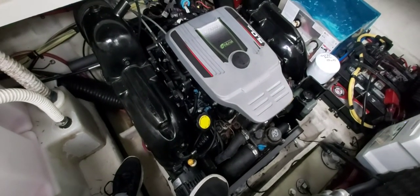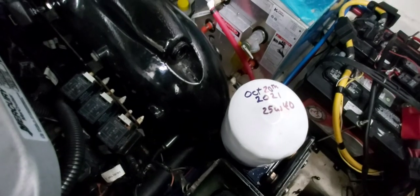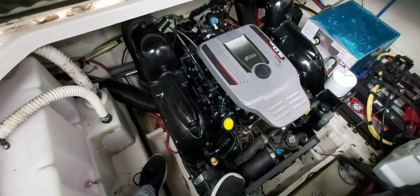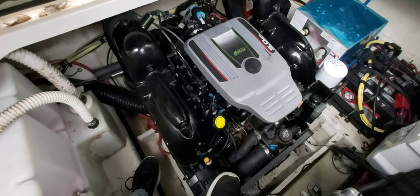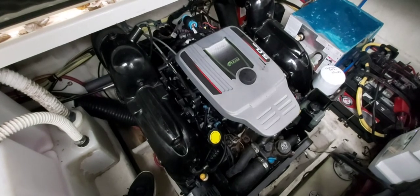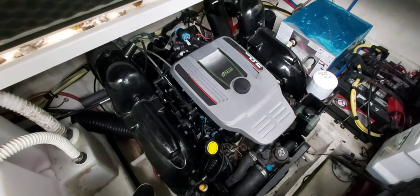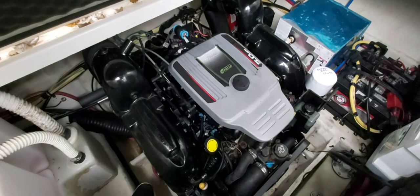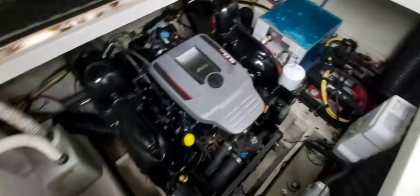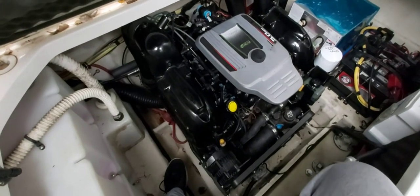So I've topped up the oil — it pretty near took almost exactly five liters. I've put the date on the oil filter and what type of oil was used. The next step is we need to winterize the motor. The outdrive gear oil has been changed, the engine oil and filter is done. The next video will cover getting rid of all the water and replacing it with antifreeze for the winter months, as it gets almost minus 30 here in our area. Once that's done, we're going to detail the engine bay, remove the two boat batteries, and make sure this is spotless for springtime.